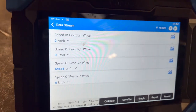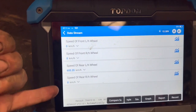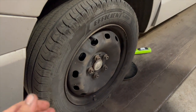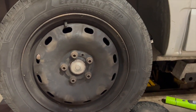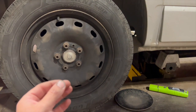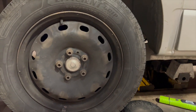Just put this on the offside rear wheel and give it a quick spin — we're getting nothing out at all on that. If we go to the left-hand rear wheel and spin that up, it is actually reading, but it does say rear right-hand wheel. So it's a nice little check — although it is wrong, we can use it to confirm we're definitely looking at the right wheel. So we're going to get the wheel off, get it up in the air, and have a quick look at the ABS wiring loom. I'm fairly certain this is going to be a fault relating to the ABS sensor — the sensors for these are really cheap, and it's a lot cheaper to try this first rather than pulling all the wiring apart.